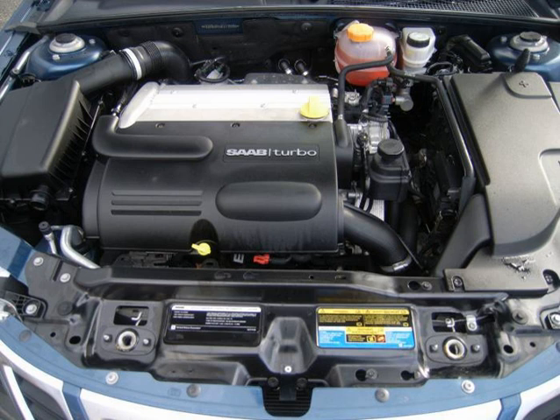The engine features dual overhead camshafts with continuously variable valve timing and increased authority cam phasing, increased phase rotation angle, a high-pressure returnless direct-injection fuel system with camshaft-driven fuel pump delivering 750 PSI at idle and 2,250 PSI at full load, higher-flowing intake and exhaust ports in the cylinder head, electronic throttle control, and pistons with jet spray oil cooling.